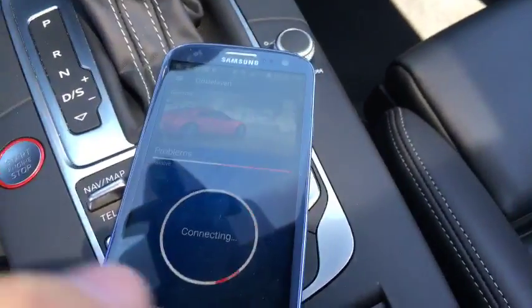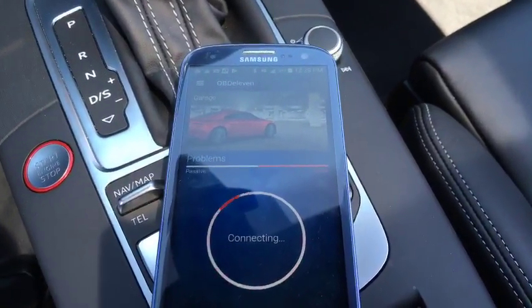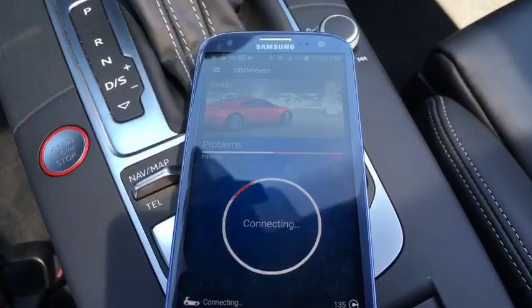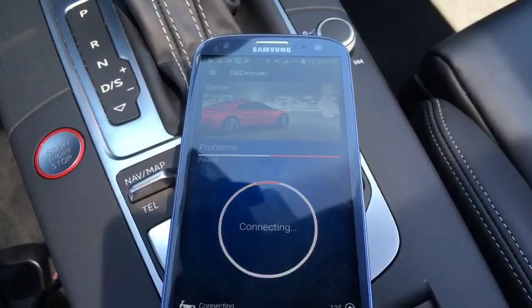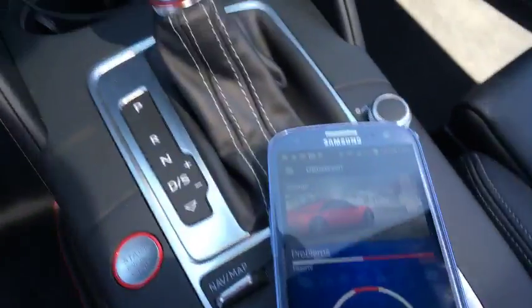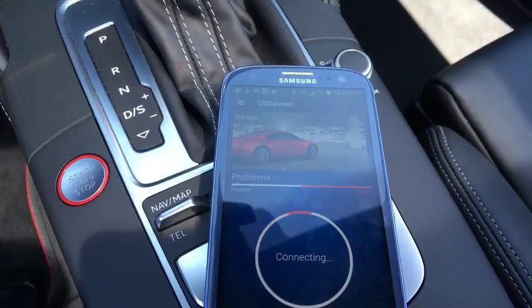So anyway, back to this. God, we keep getting derailed here. You go into, I believe it's vehicle settings 19 or something like that. And then in the adaptation, you'll find an auto start stop system in there. You would change the voltage value from, I believe the default is 7.1, and just move it up to 12. Basically, the car is setting this baseline. It's like an if statement. It's saying that if the car is above, I believe it's above 12 volts, no, below 12 volts. Below 12 volts, because it doesn't make sense.